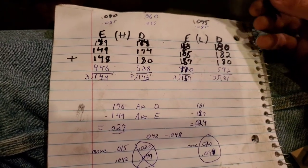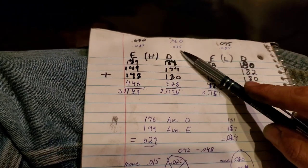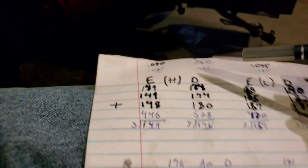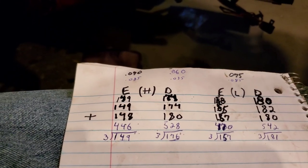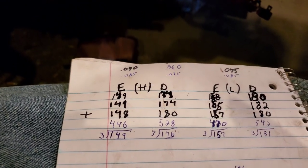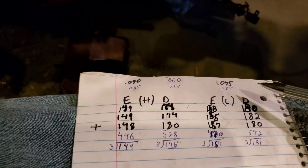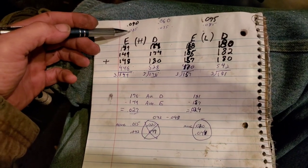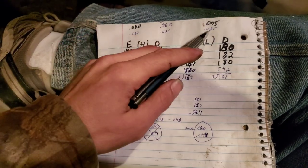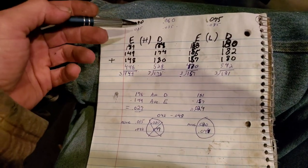One thing I did not note: it's a good idea to write down what you're starting off at. This is what a new clutch starts off at — each of the outside ones are 85 thousandths, and then the middle one is 35 thousandths. That's a clutch that's never been adjusted, or a fresh clutch. It's always a good idea to write down what you're starting at, just in case you mess something up.